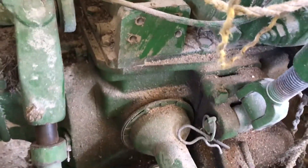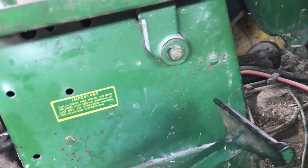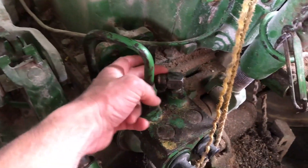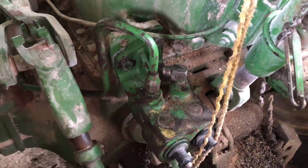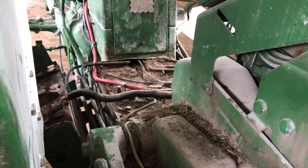The remote just mounts to this plate back here. We got one line ran through and it goes right along the side here. It's a two-piece line — it goes down here and then underneath this cover, where it connects to another line that comes across the back side and connects to the valve. The kit did come with two metal lines, but the other metal line must have gotten tweaked or isn't quite right for this year of tractor.